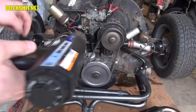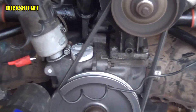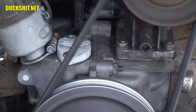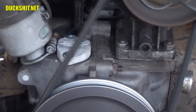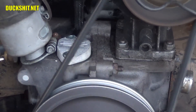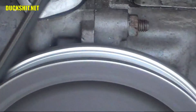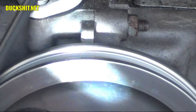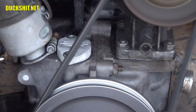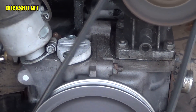All right, let's fire it up. Set the zero degrees over here at idle - I don't know how well the camera picks it up, let me zoom in. At idle you should be seeing 7.5 degrees, that's what I'm seeing - looks like it's almost 10, and 10 is actually where a typical 009 distributor is supposed to be set at. Let's rev it up. You probably saw that it maxed out right at 30 degrees. 32 is recommended - anywhere between 28 and 32 is where you should be. 30 is where it's at.